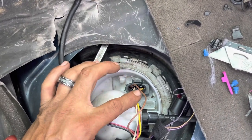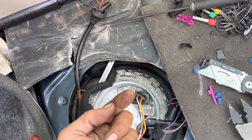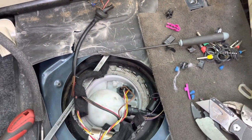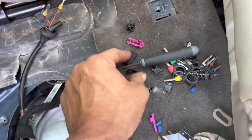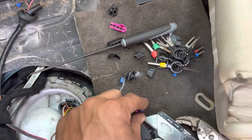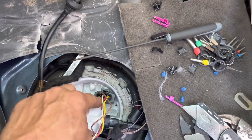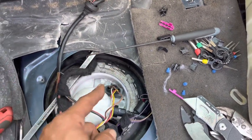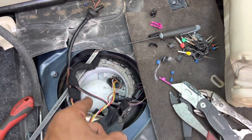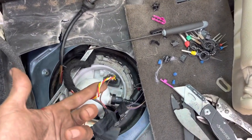For practical reasons, it would have been better to get the correct wiring connector off of the fuel pump in other year Audis. When you pull it off, make sure you look at the base of it like I showed you, to ensure that these are nearly the same. I took this one off of an ignition coil and it wasn't exactly right. I ended up having to cut the blue tabs off because I made a mistake and didn't get it locked down properly the first time. So what I'm going to do to address that is just use some black silicone and put it down in here, because on the top of this particular gas tank it could get some elements splashed up inside there. But this is a very practical, sensible repair that you can do by just going out to your local pick-your-own-part or even your local junkyard.